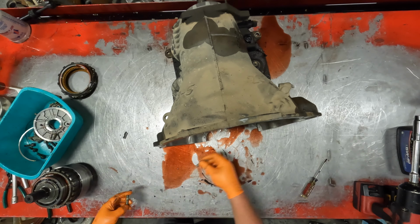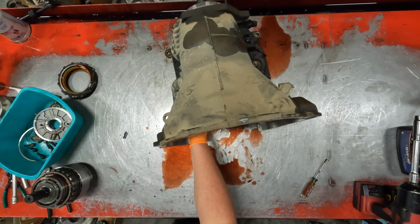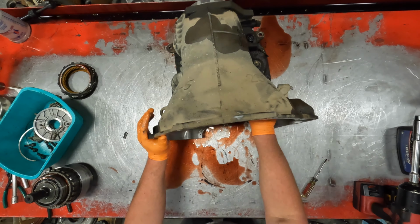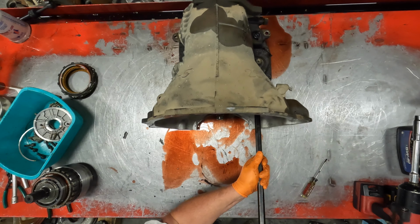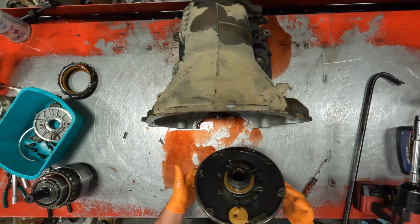Oh, I was saying earlier, take two of these bolts, stick them in the front of the pump. Grab me a crowbar. That's my pump puller. Redneck pump puller. That's what I got, that's what I use. Walk over here and get me a bar. Two of the overdrive housing bolts and a bar stuck in the pump. Pump'll be right out.